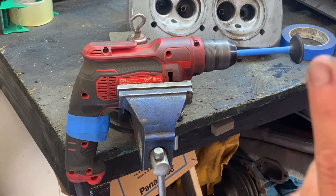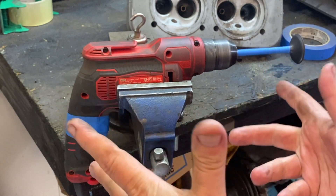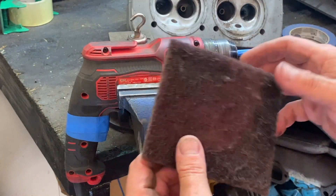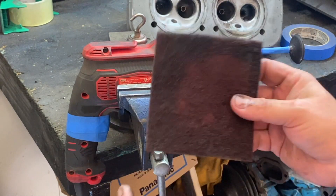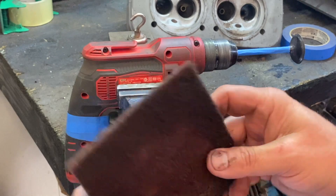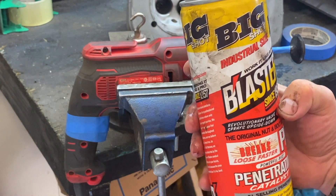We start and stop using the plug, not the button. Make sure you have no gloves on - you're going to get dirty, but that's okay because you're building a motor. You need to pick yourself up some of these red 3M scrub pads; there's a link down below. We want these to clean off all the carbon that's been building up on the valve. You can use WD-40, but I like using PB Blaster.